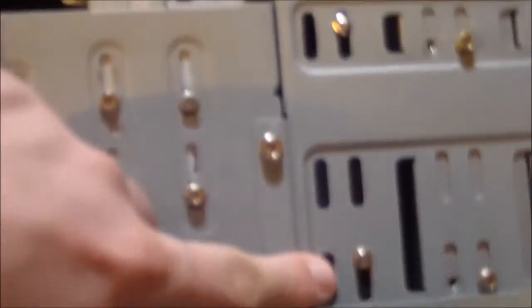Alright, so I actually have the solid state drive installed right under there. It's pretty stable because it's really light, so it's just hooked up right there. I took out the old hard drive. The zip drive I left in there, but I just disconnected it. The CD-ROM drives are just going to stay on the IDE bus. So now I just got to install that RAM right there, and then I'll put in that SATA adapter card, and then we'll see if I can install Windows XP on this thing.